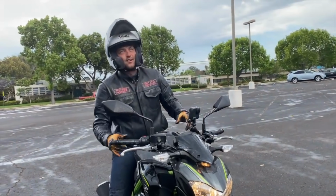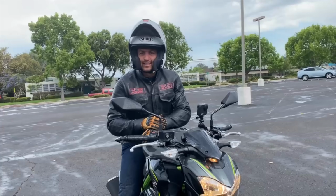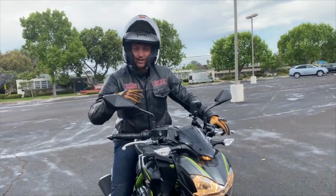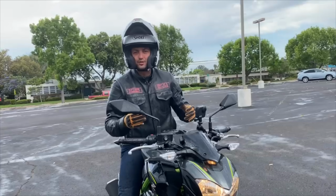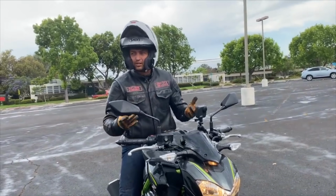Of course, you practice, right? But you're not going to do this for an hour straight. Heat is the enemy. Unless you're going really hard, high up on the RPM, slipping the clutch will be fine. It's bathed in oil, you'll be all right. Just give yourself and the bike a bunch of breaks to let everything cool back down. A little bit of practice frequently, and you get pretty good at it.